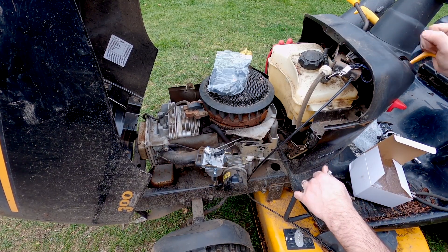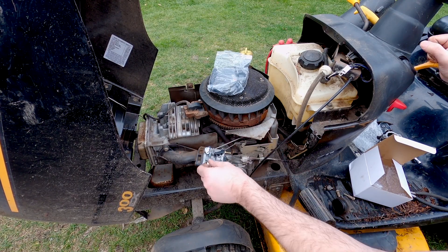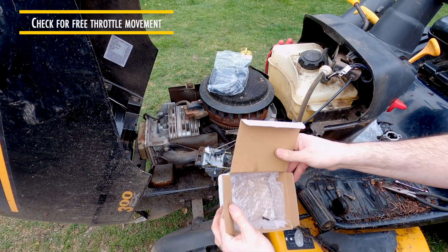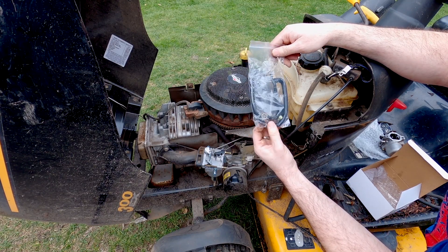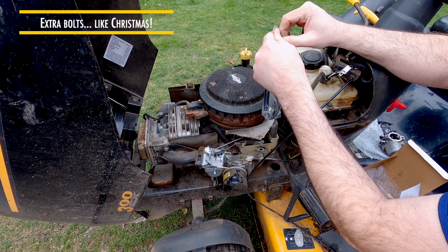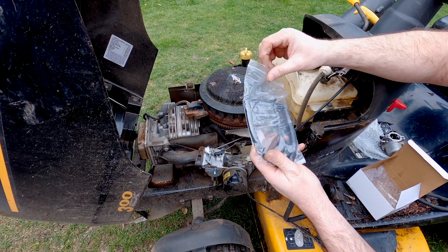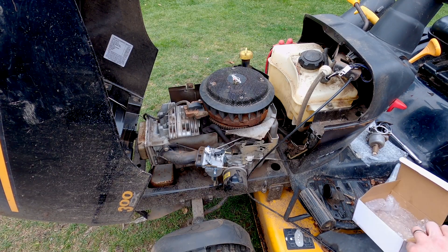Okay, that's on. As I throttle up there's clear motion — this is the governor off of the engine that's going to go back and forth. This is the idle screw, and I believe that's the low or the high screw. If your kit came with some extra filters, there's a little piece of hose and a cap for adjusting that mixture screw. A lot of these have a retainer that prevents adjustment. My old retainer was rusty so I can replace that — this one has a cap covering the mixture adjustment, so I'll grab the one from my new kit.